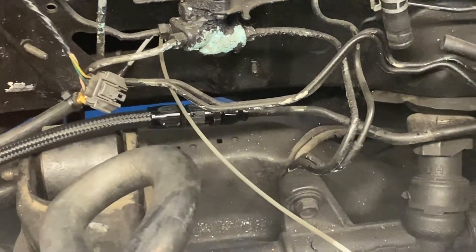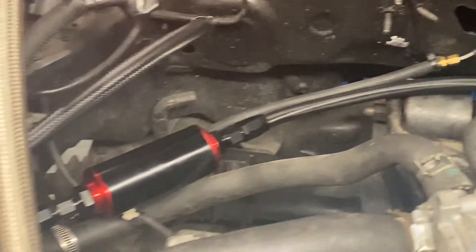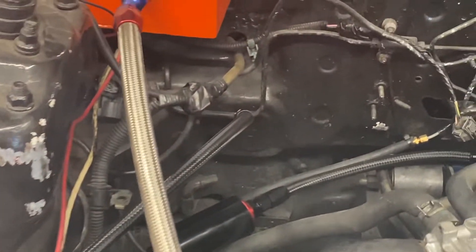Previously I mentioned we were going to do a fuel line, so I built the line off camera. It consists of 6AN line itself, a couple swivel fittings, and an inline filter, which is something you can pick up — you can buy all this stuff off Amazon or eBay. Back here you can use a fitting and adapt it to the factory steel line, and then the whole setup is ready to go.